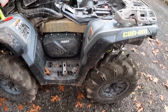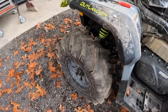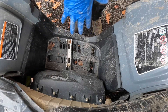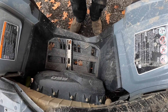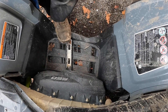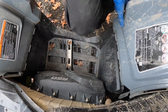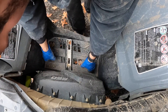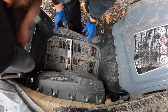I'm also going to have them go over all the factory clamps just to make sure, because when you're going deep you don't want any leaks. We're also getting the tires off - might do a rotation since I haven't rotated them yet. I know there's a ton of grass stuck in the CVs. To actually remove the footwell after you get all the bolts out, you have to kind of step on the footwell and give your plastics a pull. I know it's a scary sound and feeling but it's the easiest way I've found - haven't broken them yet.